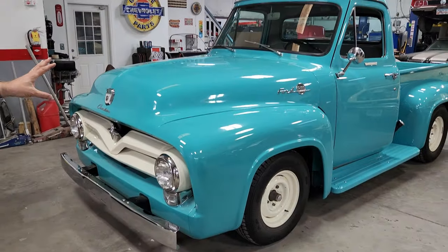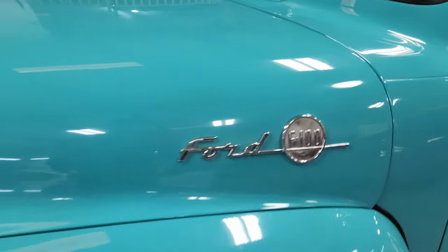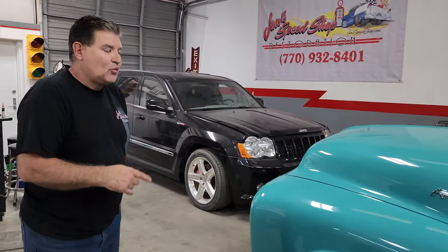Original straight six — it's a Ford 223. She recently came in with a sick motor. We had to rebuild it — we had to sleeve it on one cylinder, bore it, make custom pistons 80-over, and just rebuild the whole thing. We crossed our fingers for parts, given that we're in this day and age.